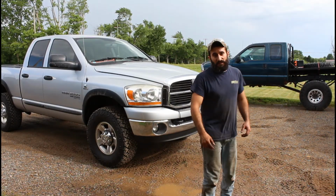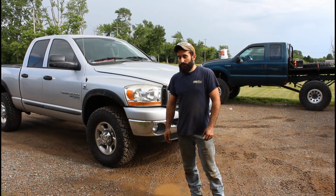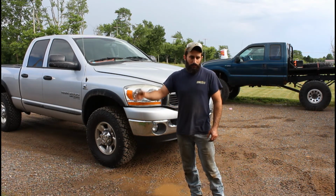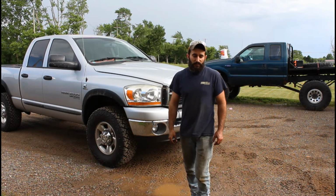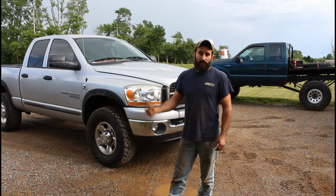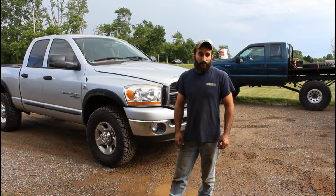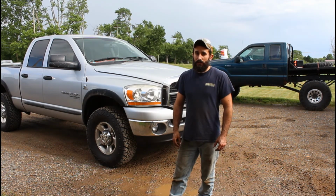Alright, so the camera died on that last video, but it's not too hard. I'll just tell you what to do. Fill up your radiator, let the truck warm up. The thermostat will open, water will get sucked through the engine. Once that happens, you can go ahead and top off the radiator in your tank, your coolant reservoir. Fill those up. Run it for a little bit and see how it is. You might get some air bubbles, you might gargle a little bit, that should be fine.